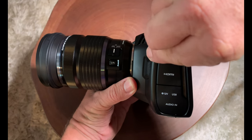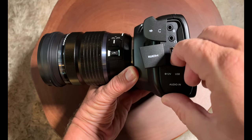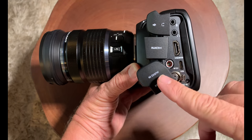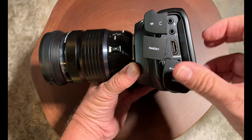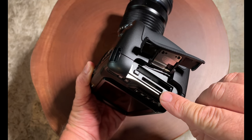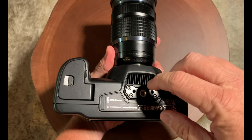Let's take a look at the connections on the outside of the camera. On the top you have your microphone input and your headphone jack. Over here you have a full-size HDMI. Then you have your 12-volt power supply on the left, your USB-C, and your mini XLR audio input — those are the connections on the left side. On the right side, in the front slot you have a CFast card slot, and on the back you have your SD card slot. It closes with a reassuring click, and there's a nice quarter-20 mount on the bottom that seems to be reinforced really nicely.